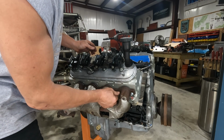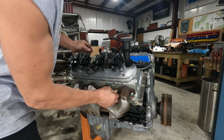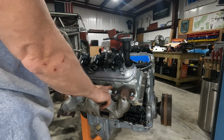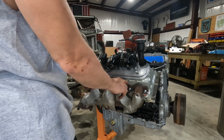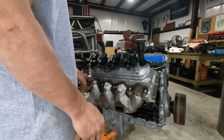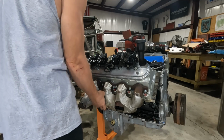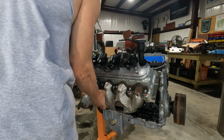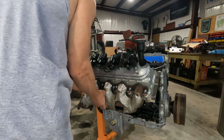I mean, we got an 8mm bolt going into an aluminum head. And I do know we're going to start in the center here, and then we're going to go out. We're going to start there and go out and basically work this thing out from the center out. So that's a given. And now we'll put anti-seize on the outer 2. We should be good.